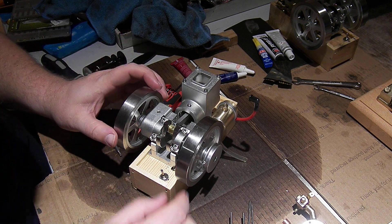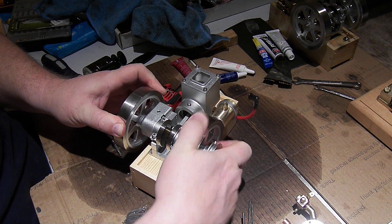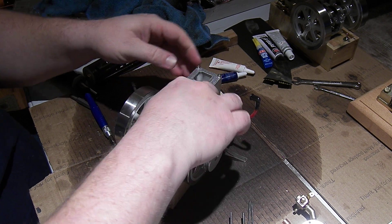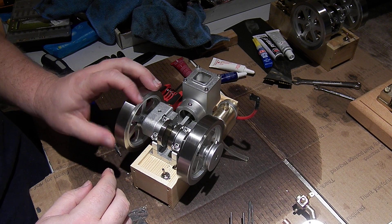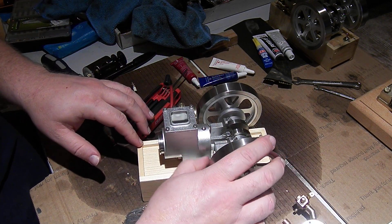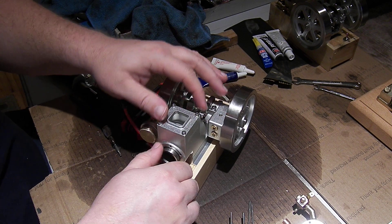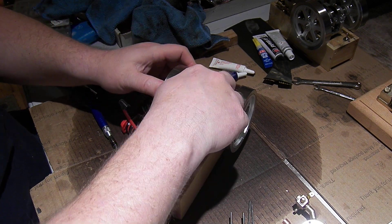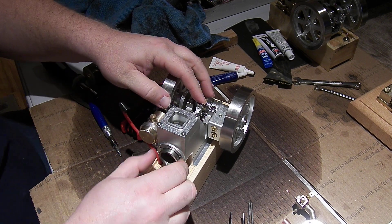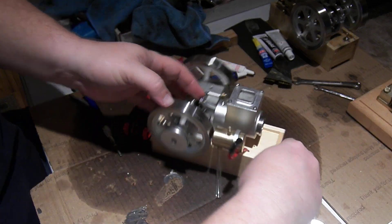There's definitely oil on the big end. That must be what happened — my guess was correct — because it's free now that I have the piston disconnected. That cylinder is really tight in there. I've never had the cylinder liner be so stuck in one of these; they usually slide right out. They must have a new sealer design that they're using with these now.